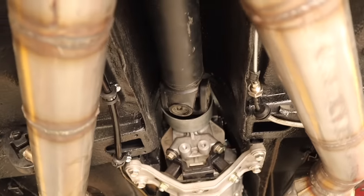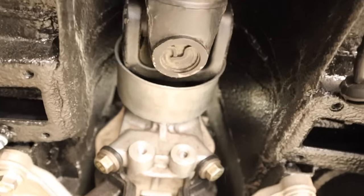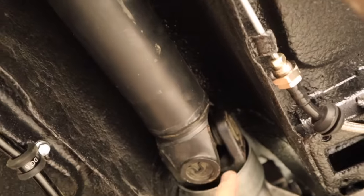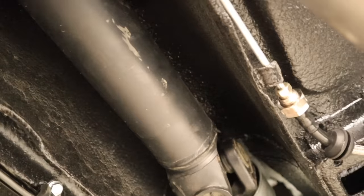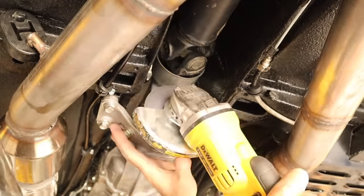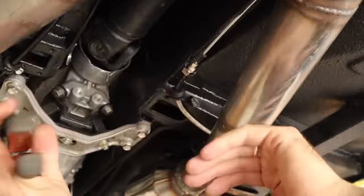I also found the horrible noise in the gearbox - if I turn the tail shaft it's rubbing. I basically just need to clearance this housing a little bit to give more space for the tail shaft, and that should be all right. I didn't get around to trimming all of it so it still needs a little bit more attention later.